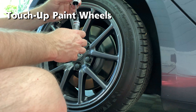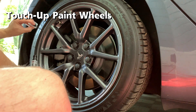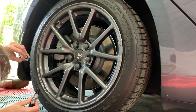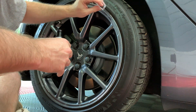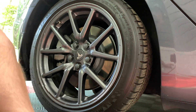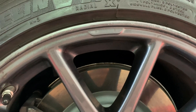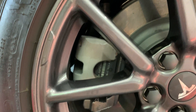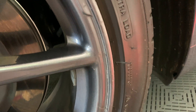For the next step, I'm going to use touch-up paint to repair any scratches or nicks on the outer rim of the alloy wheel. Once complete, I let it dry for two days. By the way, for the aero wheels, the Duplicolor Dark Shadow Gray is a great match for the Tesla wheels. Here is a close-up of the touched-up wheels — it's not perfect, but from a few feet away it looks fine. Note that these wheels have been previously repaired due to curb damage, which is why some of the edges are rough.